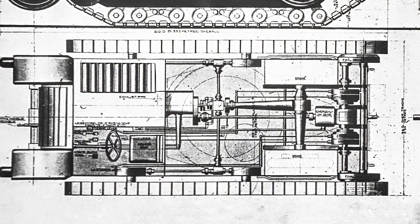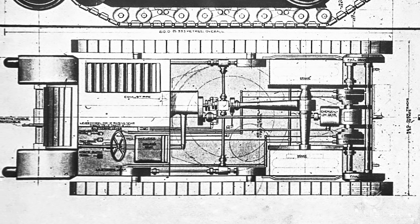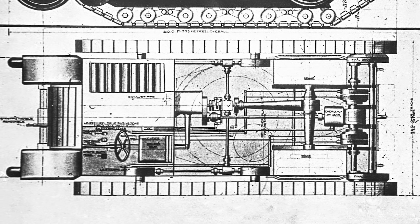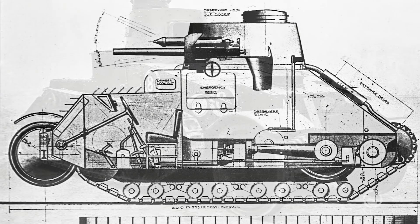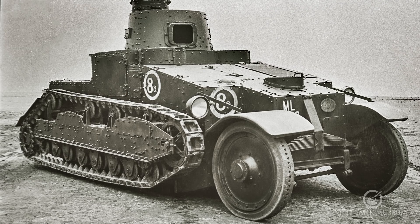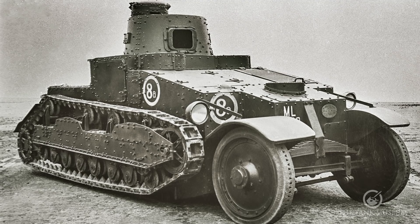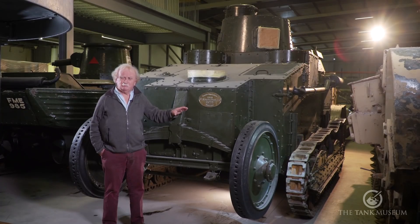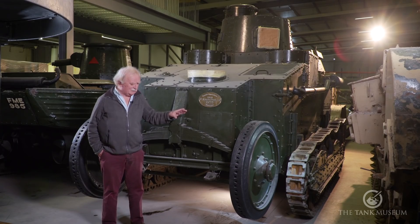The tracks are on a framework fitted to the side of the vehicle and they move up and down on rails on the side of the vehicle. When you go up close and look at them, they don't appear to have any sprung suspension at all. They do move — each wheel is on a sort of bracket arrangement and they work rather like the American light tanks, the early ones. They adjust to the ground and to one another, but they're not really sprung in the proper sense. So they give an even harsher ride on the odd occasions when you use them.